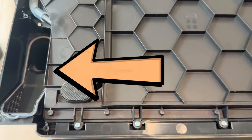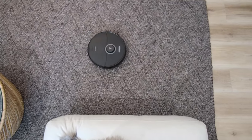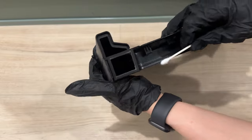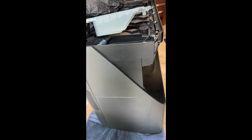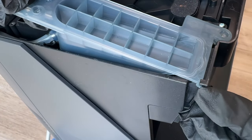My next tip is also a Roborock recommendation: clean the air duct as required. In case you're wondering, this is the air duct. I don't think you have to clean this weekly or even monthly — maybe every six months or even annually — but of course it's all relative to your environment. However, if the dirt in the internal dust bin is not being sucked up into the dock's dust bag completely like normal, then you may want to clean the air duct. To do this, remove the clean water tank, dirty water tank, dust bin, and the robot vacuum. Disassemble the dock base and check for any blockage — pull it lightly upward to disassemble. Then clean the air inlet with a cotton swab if it gets blocked and wipe it with a dry cloth. Carefully place the dock upside down on a hard floor covered with a soft towel. Unscrew the three screws and remove the cover. Wipe the air duct and the cover with a dry cloth, then reinstall the cover and screw it back in place.